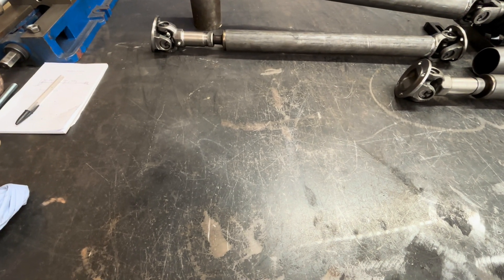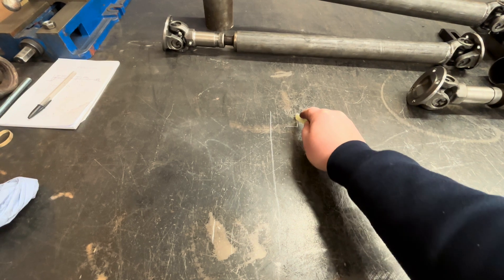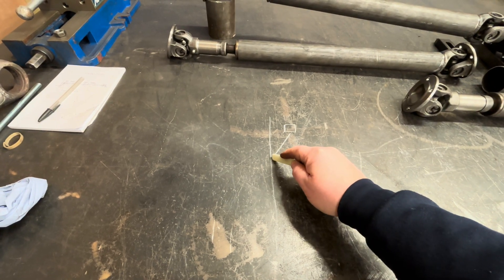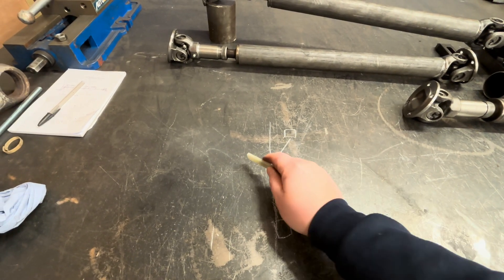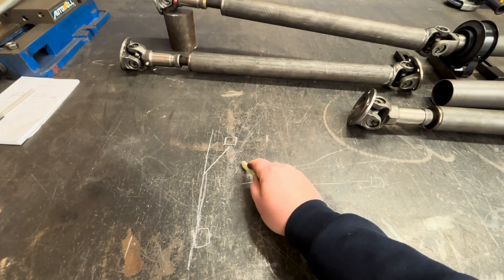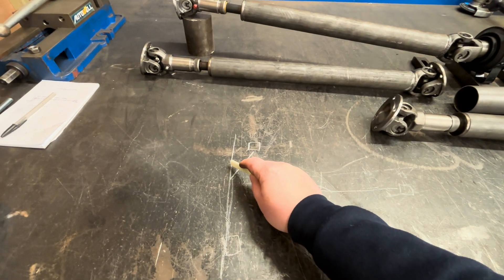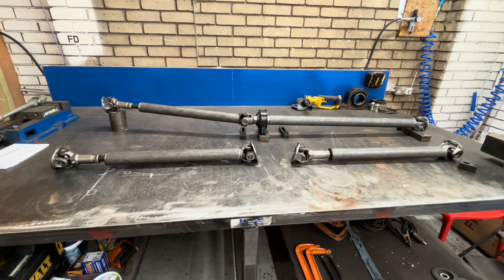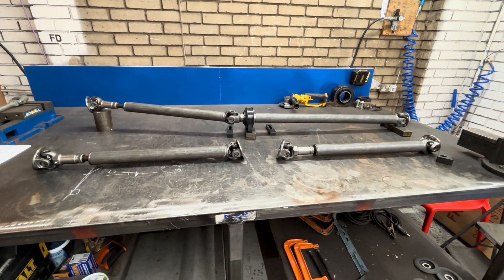Just a quick drawing to show the plan view. If this is the center line of your vehicle, a lot of motorbikes tend to have the engine offset, so that angle comes down to the center bearing here, and then the center bearing runs perfectly straight to your diff at this end. With that being raised up, from the side view if we have the plan of the vehicle, the diff is here and the gearbox is up here — you've obviously got this angle coming down as well. So you've got two angles: this angle here and this angle here, which creates a compound angle.